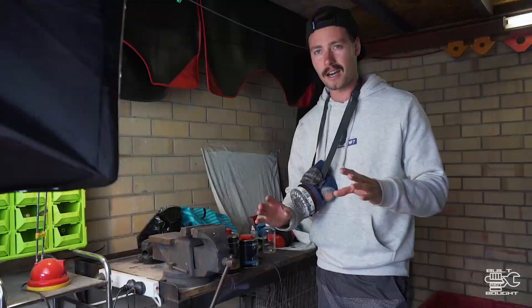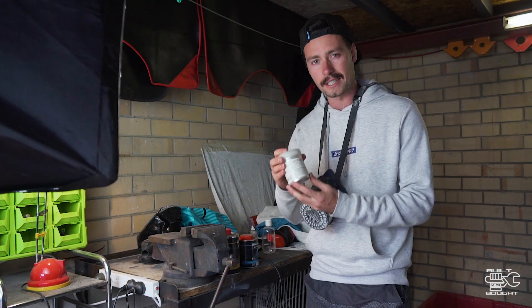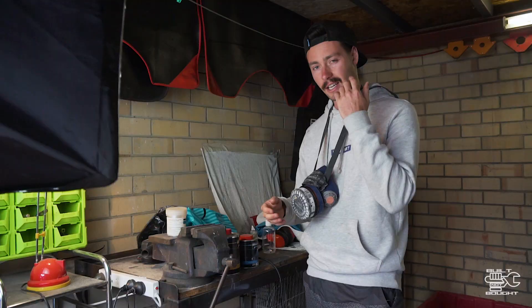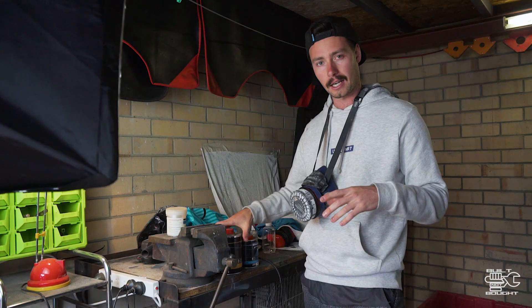Alright, so I've got the main colour on now and I'm just about to do the coat with the clear and the pearl. I've put the pearl in the actual clear coat this time because it's the powdered type. Normally with metallic paint you put a silver kind of paint into the colour, but with powdered pearl — it's kind of like a fine dust — it's very transparent, so I'll put it in the clear coat because it will give it the most sparkle and fleck when it's in the sun. That's just one thin layer of clear with the pearl in, and now it's time to do the main coat of clear. It's a two-part — there's the clear and then a hardener — so this will give it that strength when dry. Probably two or three solid thick coats of clear, and depending on the final finish you may or may not need the final stage, which is stage four: polishing to get it to a glass finish.